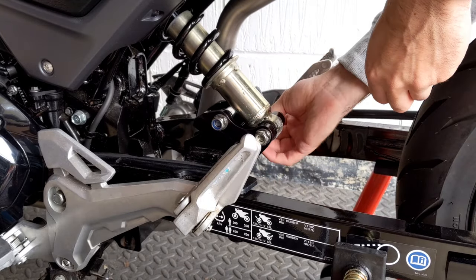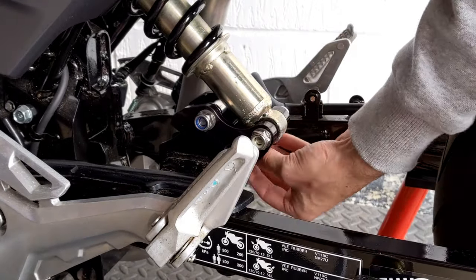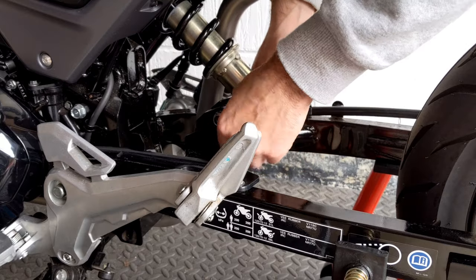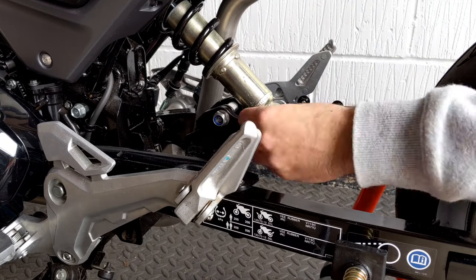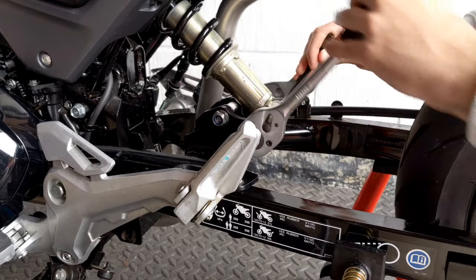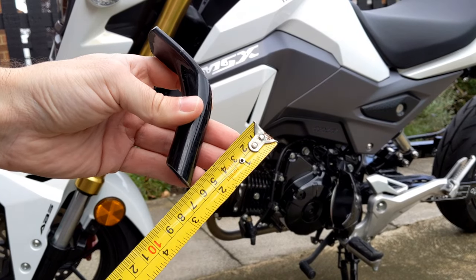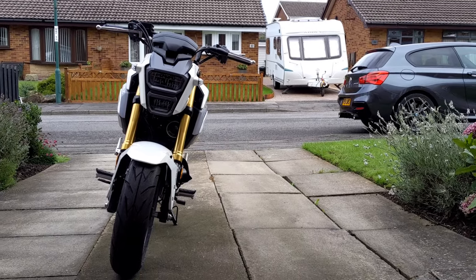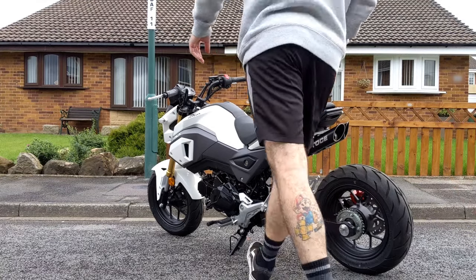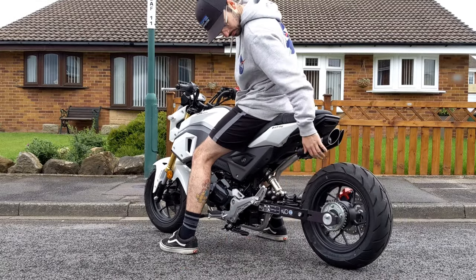As for the installation of the lowering link, you've probably noticed I've been fitting it in the background while gabbing on — it's really simple to install. It's literally just a case of taking the bolt out of the bottom of the shock, attaching the link to where the shock used to sit, and then refitting the shock to the holes on the far side of the lowering link. It's probably a little bit easier with an extra pair of hands to slide the bolt in, as you need to take the weight of the bike to get the holes to align, but I managed on my own. I cut the kickstand about 60mm up from where it used to sit on the floor — it might be leaning over a little too far, but I can sort that out with a little rubber boot on the end. I'm kind of hoping that when I lower the front it'll open up the space between the exhaust and the rear tyre, because with me sat on it there's next to no room for a licence plate.